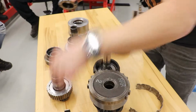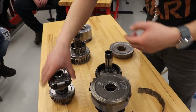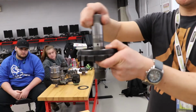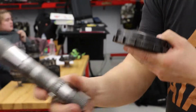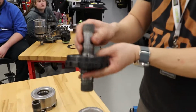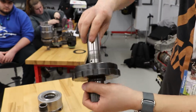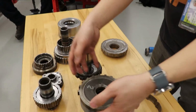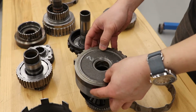Essentially though, this is your planetary gear set, your compound planetary gear set. It's all there, plus the ring. Now, the rear ring is splined to your final drive sun gear drive shaft. Final drive sun gear drive shaft, okay? Splined. If the rear ring turns, the final drive sun gear turns, right? So at this point in reverse, we know that it's turning in this direction, that way, to the rear of the car. That means I'm going to remove this. Notice these lugs here.